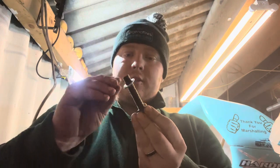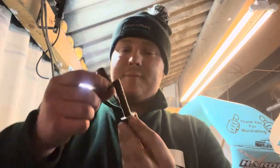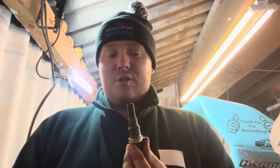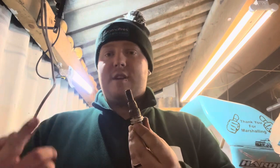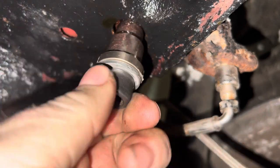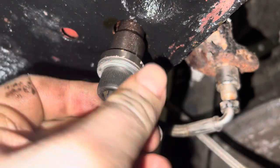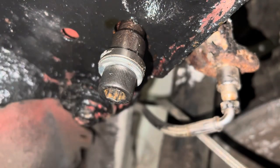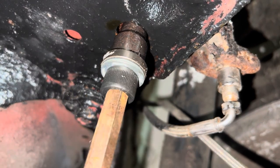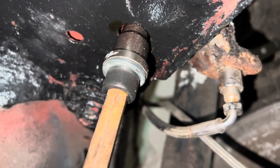Put the washer on first - very important, don't let it slip around. Then you're going to have your spacer, all copper slipped up so it's not going to seize and you'll be able to remove the subframe in the future if you need to. The hardest part is probably cleaning the threads. Run this bolt straight up into that subframe - once the threads are clean you'll be able to start threading up the spacer and bolt and it should be quite smooth. That spacer is going to start working and moving the subframe, so you have to use a bit of torque to push it in.